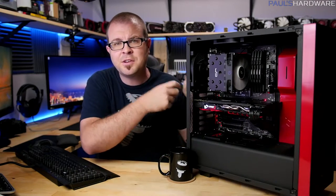If the pump fails and you don't find out about it, your CPU can overheat and just automatically shut down your system. And if you're in a situation like I've been in the past and you're in the middle of booting, for example, you can lose a RAID array or that kind of thing. That has happened to me and a few other people I know. Also, liquid coolers do have the potential to leak. Granted, that's rare, but that is something that's possible.